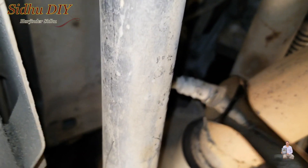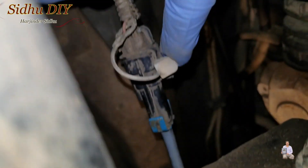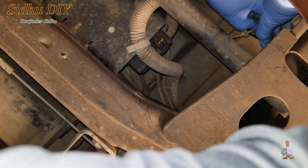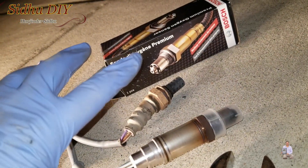As you can see, it just opened up. Once this one is loose, you follow the wiring down to right here, and we need to open the safety pin. Once you pull the safety pin, this is the connector — you pull it up and take it out. I took it out, and this is the new oxygen sensor. I'll list the part number in the description in case you need one.